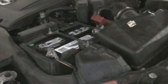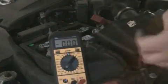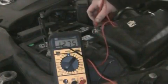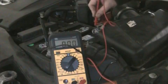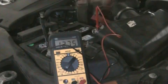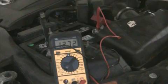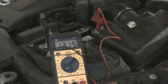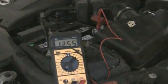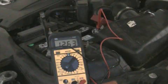Now, I'll show you what the meter reads. Set up on 20. Okay, 12.75. That is a fully charged battery. And we will get a reading with a start here. Provided that stays in place. Okay, and that's all there is to it. You've replaced your battery. Next video, I'll show you how to determine whether your alternator is bad.